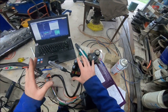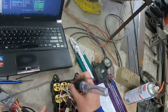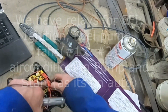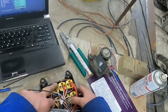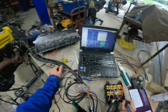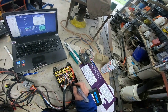When you wire it up, here's the relays and fuses. This is our EFI relay. We've got permanent battery power coming in to the relays. This one has quite a few relays — it is going to be an automatic vehicle but we've got a start relay, a spare one, an air conditioning relay for the AC pump, two fan relays, a fuel pump relay, an ignition relay and an EFI relay. I've got the EFI relay feeding voltage to the ECU itself, to the stepper and to the injectors, on separate fuses. You don't have to, but I just prefer to do it that way.